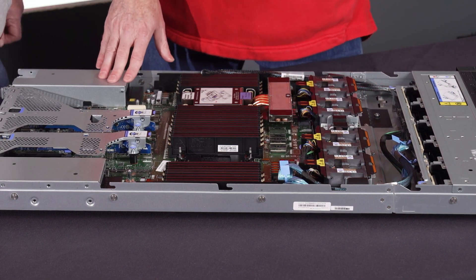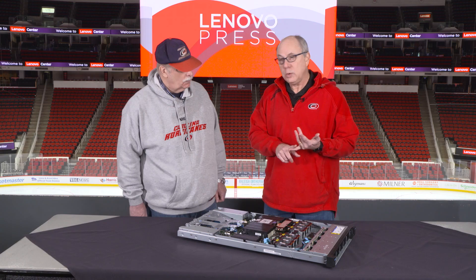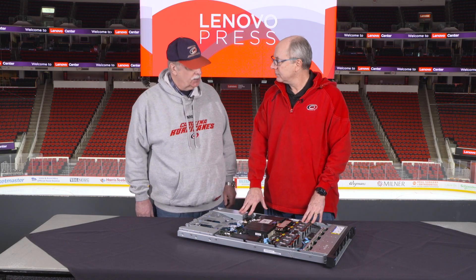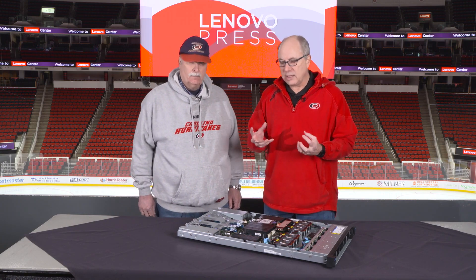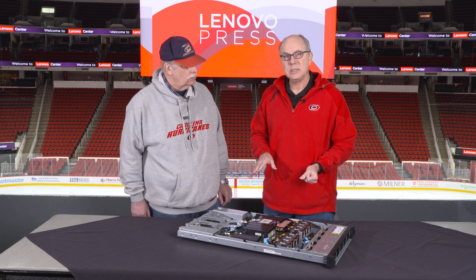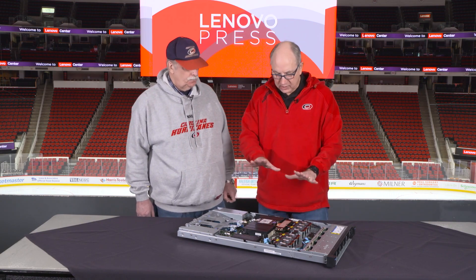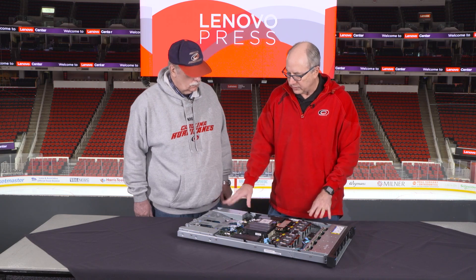Removing 80% of server heat via liquid cooling is substantial. For most configurations, you can now use slower, quieter fans that don't have to operate as fast, resulting in lower noise and lower energy consumption by the fans. You may also be able to reduce the number of fans the system needs. The use of water cooling is a substantial energy saving that's worth doing for large installations.